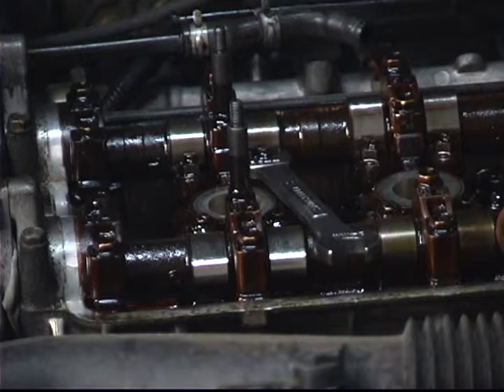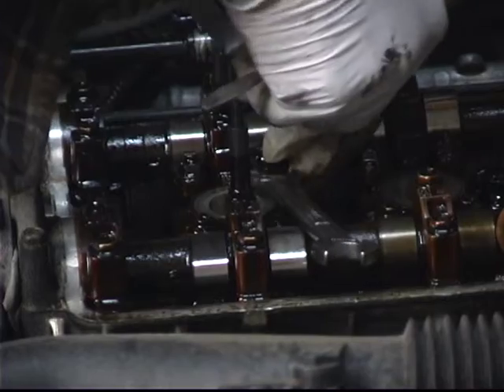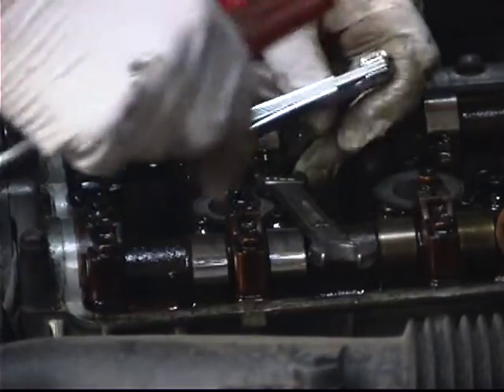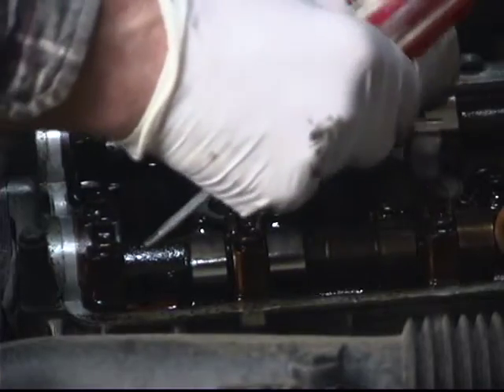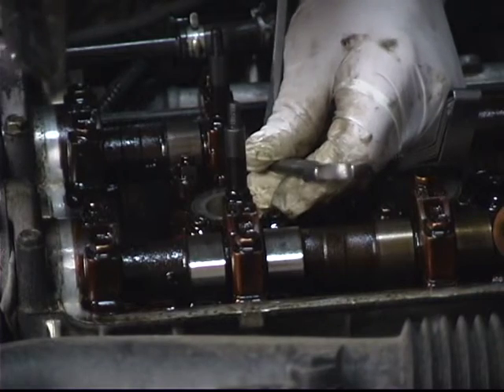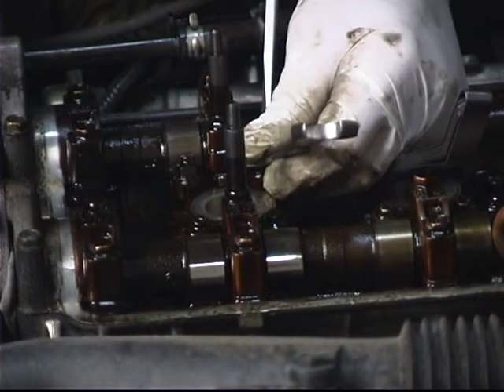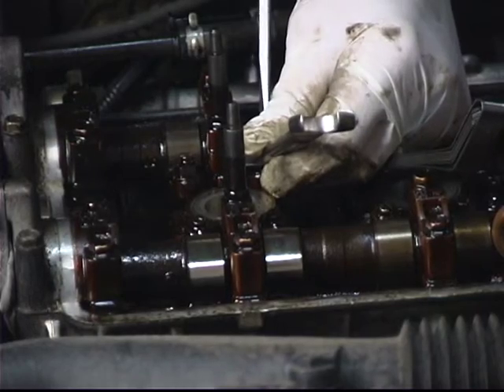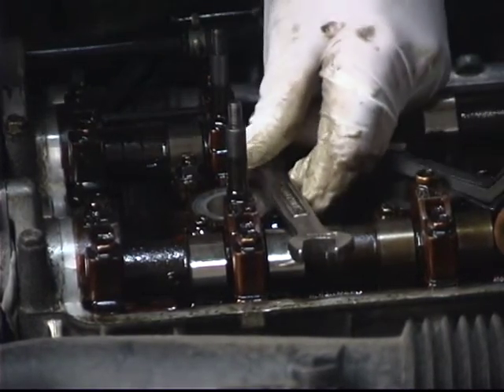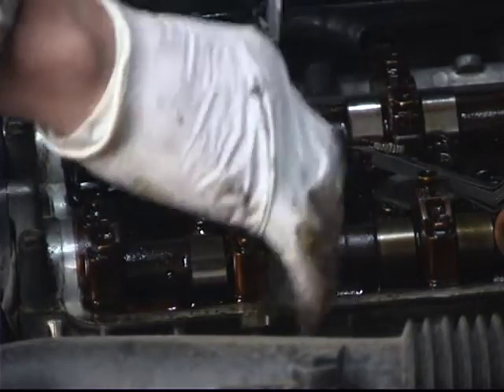Make sure you get the right one here. The oil on the gloves makes it difficult. Okay, I've inserted it. Backing that adjuster off about a half a turn. Make sure everything's good and free. Turn it down clockwise until it's snug, about fifteen, twenty degrees.